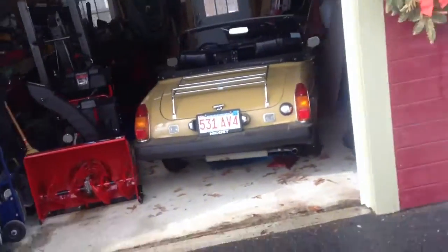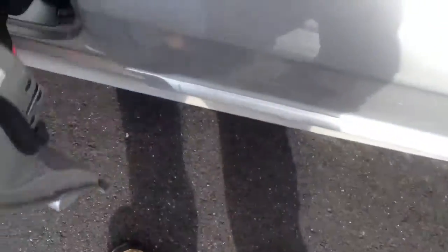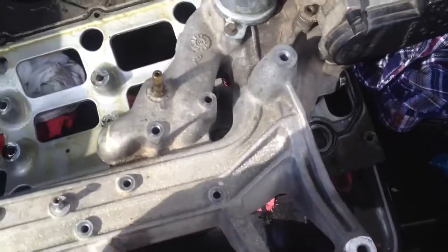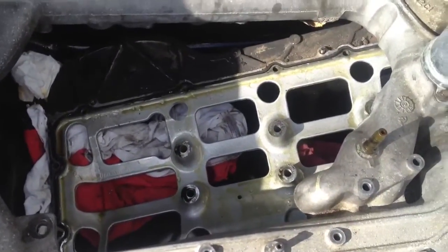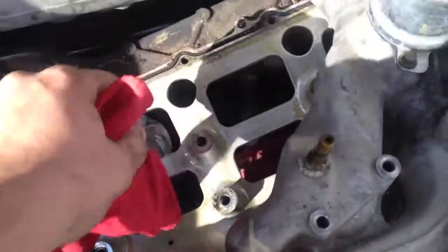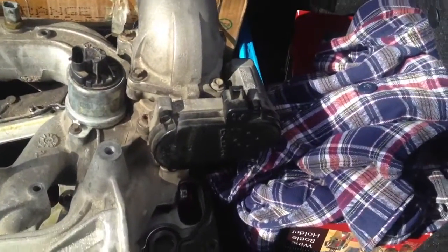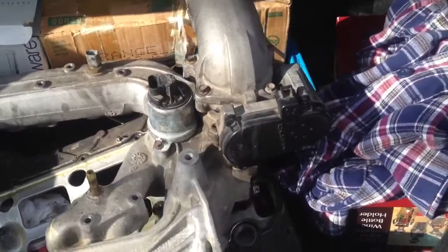The next step is to get the other parts cleaned up. There's a manifold here — I'm going to take that and get it cleaned up as well since the EGR is blocked off. Down there below that is the lower oil pan plate. There are two rubber gaskets, one and two on the bottom — I'm going to grab new ones of those. Then we'll get this thing started back together. I'm going to run over to my guy's machine shop, dip these things, soak them for a while, pick up the gaskets, and head out.